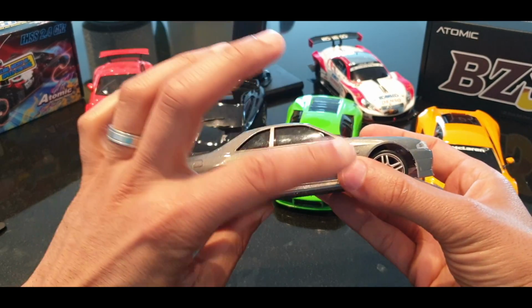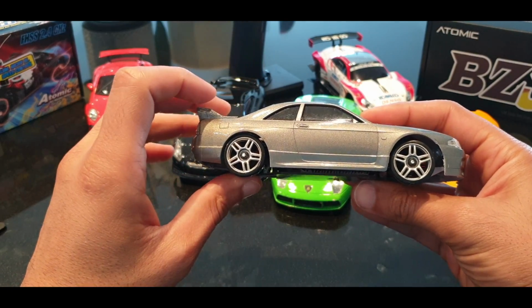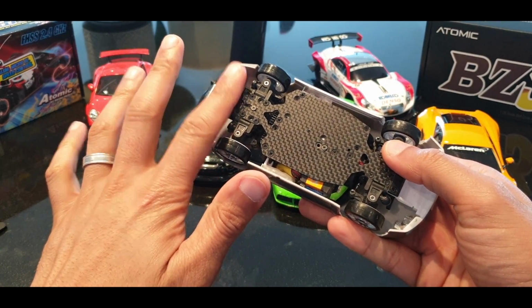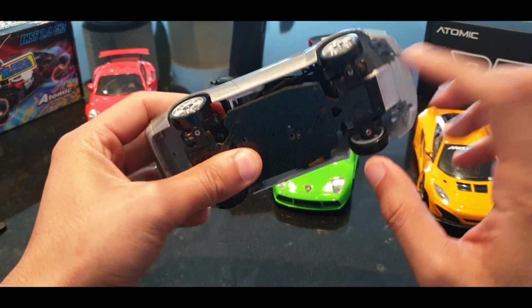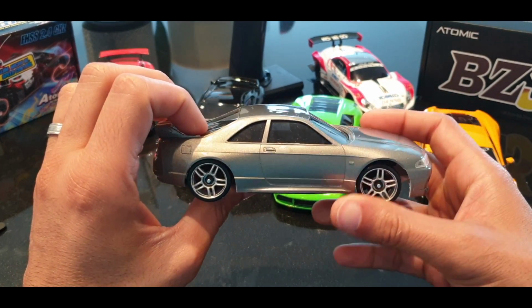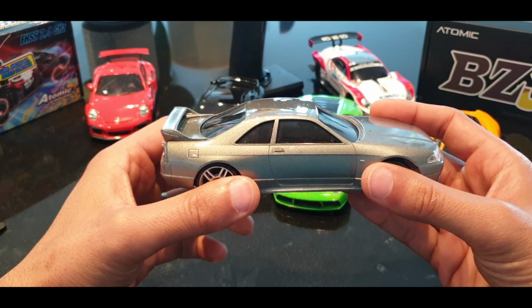94mm. So to make this 98mm and use a longer shell, you'd have to use the drive shaft that comes in the kit, move the gearbox back, and then put your bigger body and change your front clip and put your bigger body on. So if you want to use, say, an Audi R8 body on it. So that's out of the box. You can do that quite easily.